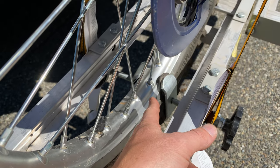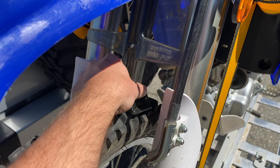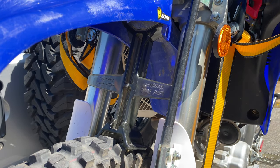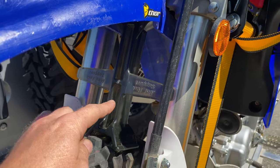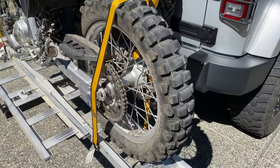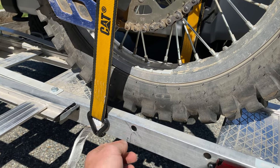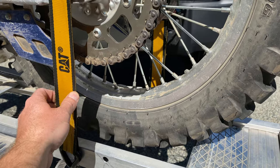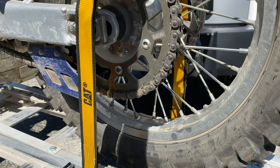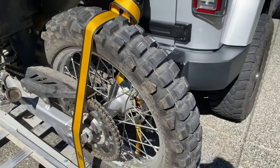This will pressure fit onto your tire to hold it in place. I'm a firm believer in using a fork support — you're going to want to use your fork support to make sure when you go to tighten things down you're not going to do damage to your front forks. Coming around to the rear, I am using the wrong tie-down straps — use ones where you can go into the holes. The hook holds the tire, and the whole objective is that when you hit bumps you don't want the tire to come out. If you go through the rim, just be careful of your spokes — you don't want to do damage and you don't want it too tight. Going over the tire is my suggestion.